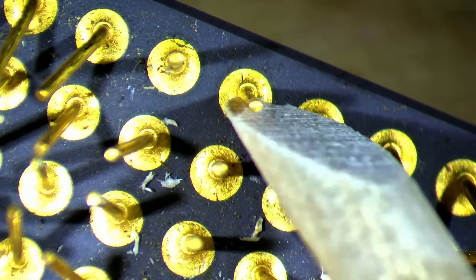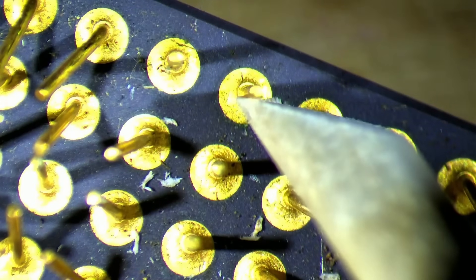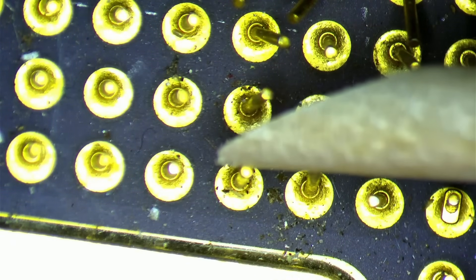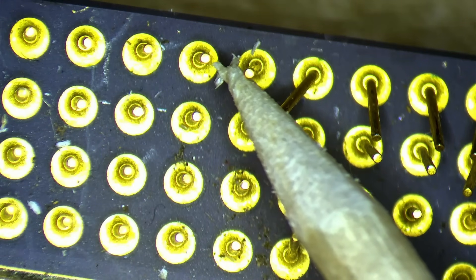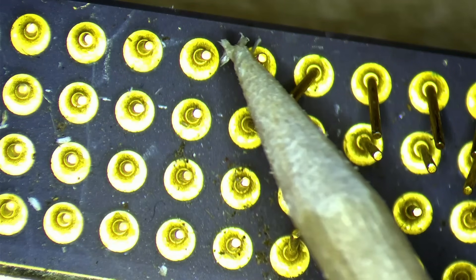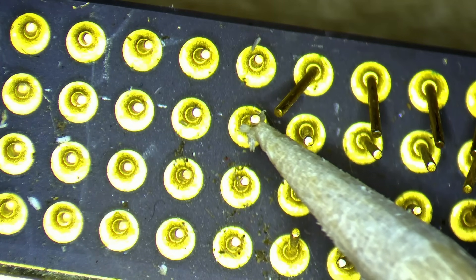I like to see how each pin is bending back into place because then I can adjust the position from where I apply pressure to the pin. My choice of bending equipment is toothpicks and those wooden cuticle pushers you can see in beauty salons for manicures and pedicures. The cuticle pushers are quite a bit thicker than toothpicks, provide a nice grip and are soft enough to not scratch the pins. And at all times I have the perfect view of the pin I'm bending.